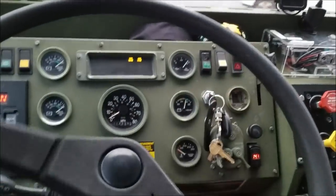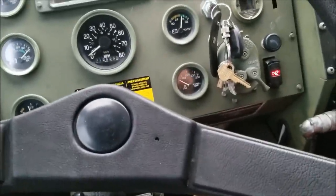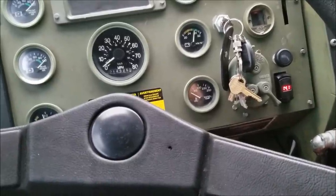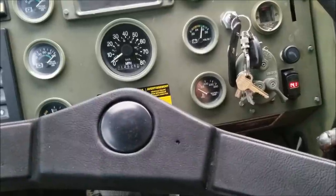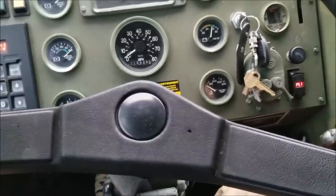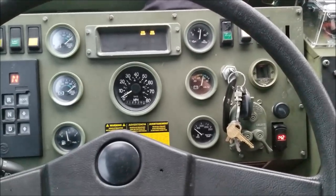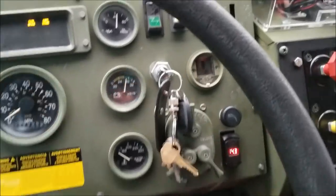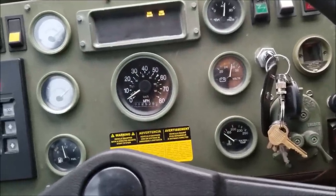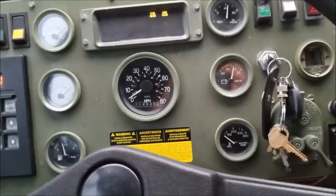Abel's been idling for about 10 minutes. I just cranked it up to high. I'll come back when temperature registers — we've never gotten it to register anything at idle, so I'm not sure. With no thermostat in there, it's most likely never going to get to correct operating temperature unless it's warm out, and that's what we were experiencing. Just from idling at normal speed for 10 minutes and high speed for about 5 minutes, I'm already getting heat in the cab, which is something we weren't able to do before. I've burped the system for the most part — I'll drive it around to get the rest of the air pockets out and keep an eye on the expansion tank.